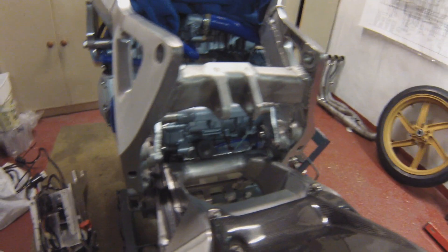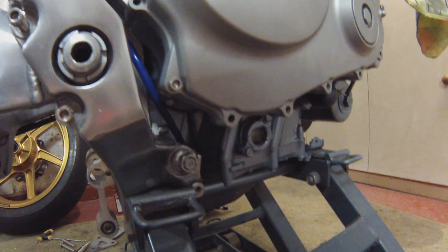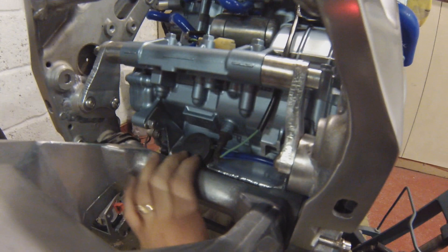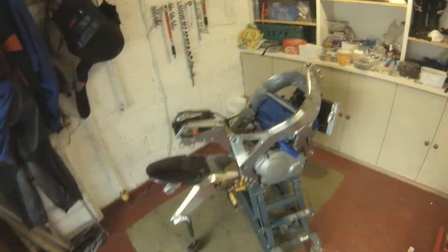All I have to buy now is the little air-equipped fitting to go onto there, which will come out. Little red and blue fitting come out here, and then that will be the take-off up to the rad, and that's just the drain off — so that will feed down under the fairings. Only one thing is the cap is really close to there and it actually touches the arm a bit, so it squeaks a bit as the arm goes up and down. But I can trim that down a tad — that's probably the best bet. So I think that's finally the end of the story for the reservoir, but I haven't water tested it yet. Check if it's watertight — but let's hope it is.